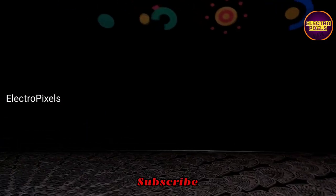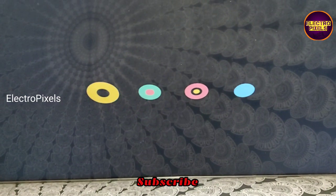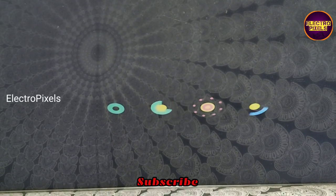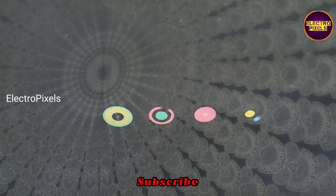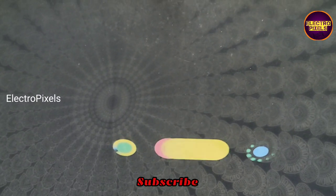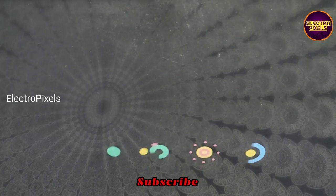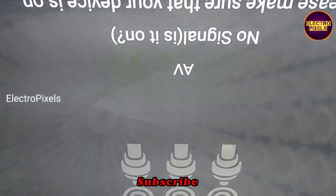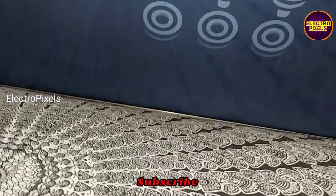As mentioned earlier, this is just a temporary solution and we cannot predict how long the TV will work using this method — it completely depends on luck. It will work until the right side gets shorted. If both sides of the panel get shorted, then it is not repairable, and panel replacement is the only solution. At present, the display is working and the TV works properly. The picture is crystal clear. Note that it takes time for booting because it is an Android TV.